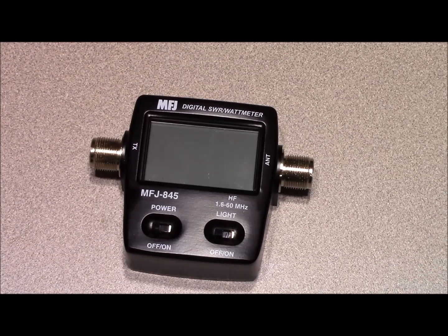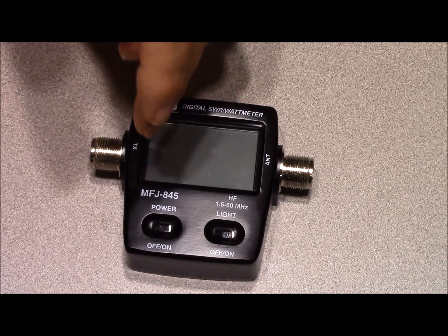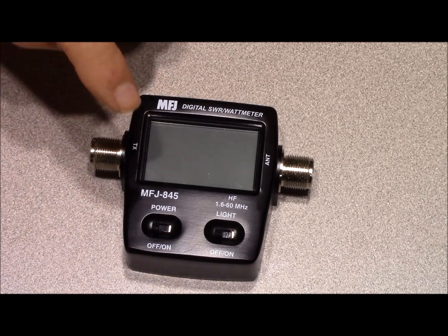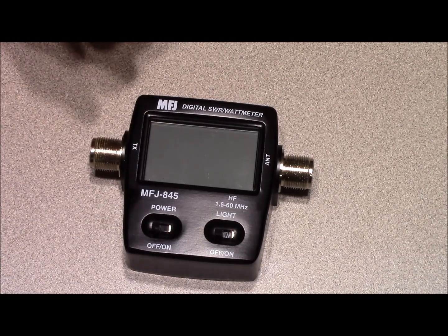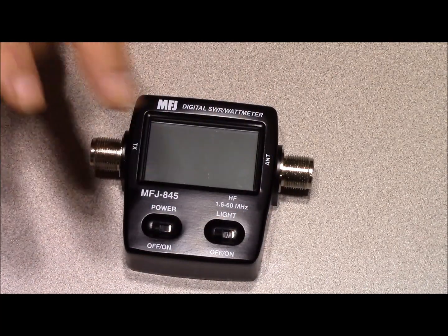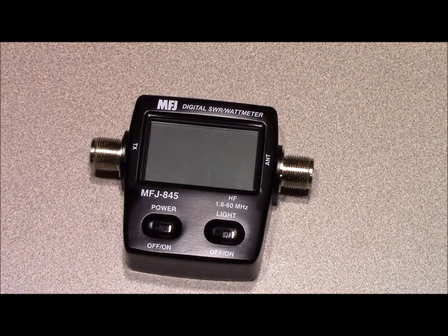Next con is the battery. I'm not a big fan of the AAA batteries. Yes, they're available everywhere, but the chances of leaving alkaline AAAs in this and having them corrode is greater than normal. It would be very easy to incorporate a lithium ion solution and have a charging port that actually charged the batteries. You could use something like an NP60 — there's not enough room for a CR123, I already checked.